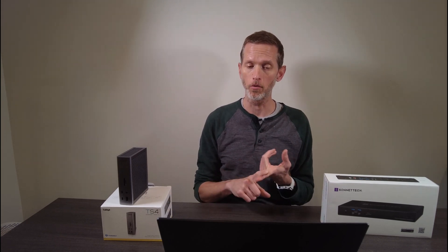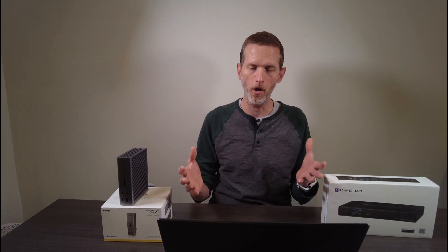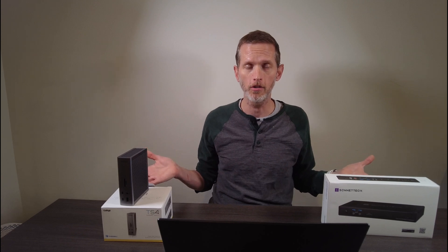Given this, I have a really hard time seeing how it's not LG's fault. I contacted support about it and they have opened a normal ticket and a voice of the customer ticket. One of the CSRs I spoke with was very helpful. I'm mostly making this video because I can't find any solid documentation around this problem — it's surprising that there's nothing pointing out that LG laptops just don't work with Thunderbolt docking stations when it comes to networking. Hopefully LG can resolve this in a timely way, because I'd really like to use either one of these docking stations for multi-monitor support, keyboard support, and wired Ethernet on my LG Gram laptop.